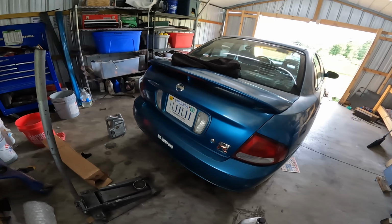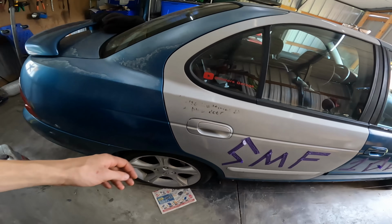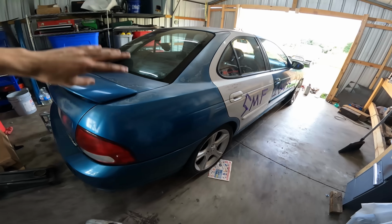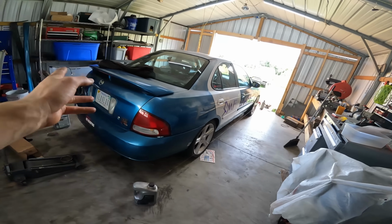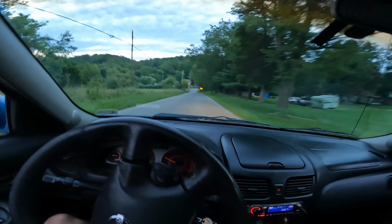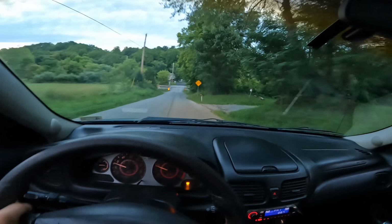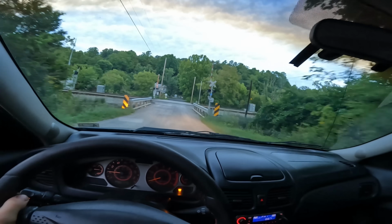So this could have gone very south, hit the fan, backfired, however you want to say it. I would have had to redo the rear entirely, but it's even. That's all I wanted. If it's too much rear toe out, we can adjust other stuff and compensate for it. So I'm just taking it for a drive right now, and this thing, the rotation is awesome. Doesn't feel like the same car. I'm excited to take this to the autocross, see what it does.